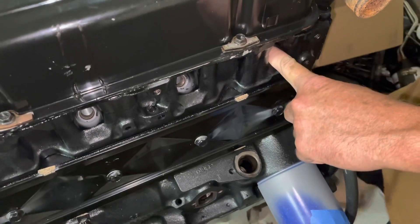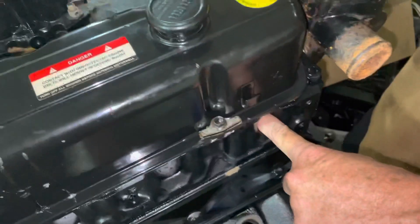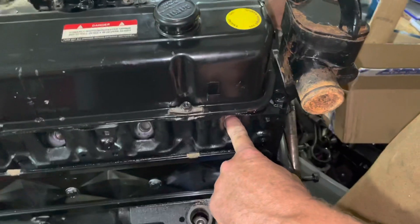So I'm about to do that now. If you listen for the hissing sound — you hear the air hiss on my finger — that confirms the piston is coming up on the firing stroke.